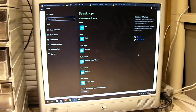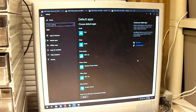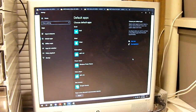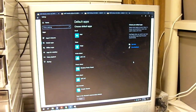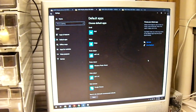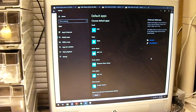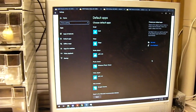So when I went to install Windows 10, I couldn't even get through the out-of-box experience, or OOBE. It would hang and freeze, and it would say something went wrong, blah, blah, blah. And I had to use a technique on bypassing it through the built-in administrator account. It was a real pain in the butt. And, of course, in newer builds of Windows 10, if you don't answer those stupid questions about the telemetry, about the advertiser ID and diagnostic data, all that crap, if you don't answer the questions in the original OOBE, anytime you go to add a new user account or anytime you go to log in afterwards, it will still start up msoobe.exe, and it will just do the same crap. And here's some footage of it actually just taking forever.